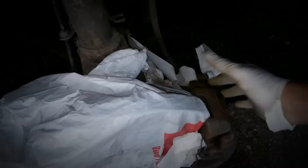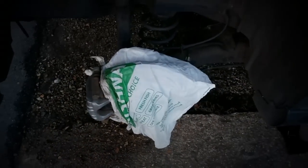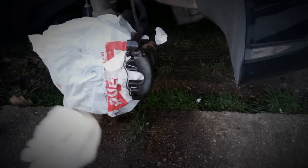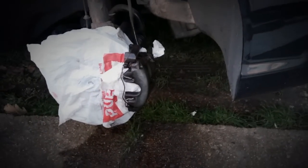Once you've scraped up all the rust, quickly mask up some of the bolts and the rubber things around the back — just mask them up so you're not covering stuff you don't want to paint. Masking up a few of the bolts and things at the back, and then apply brake and clutch cleaner — it's a heavy degreasing spray. Let that sit a little bit, wipe it off, and then you're ready to start painting. Get it around all the nooks and crannies — it's really good at pushing out grease. Make sure your surface is nice and clean and then you should be ready to paint.